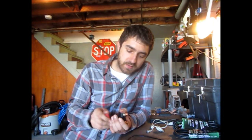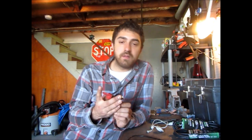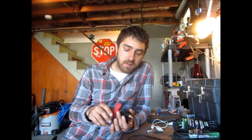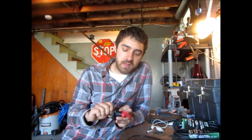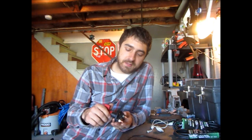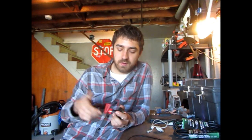What we're going to do is break the negative terminal — basically break the circuit — and find a mounting point for this thing. These are good not only for security and safety, but also if you work on your car at least once a month these will come in handy. Most of the time when you do a job on your car it calls for you to undo the negative terminal of the battery, so instead of undoing that terminal it's just a quick boom and you're done.